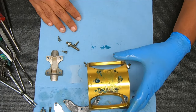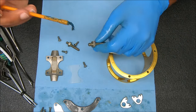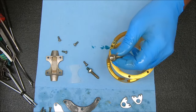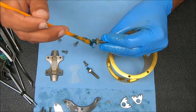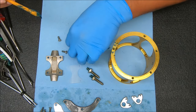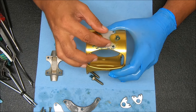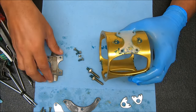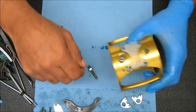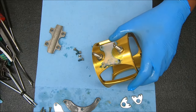Now we're gonna add some grease to these screws. There in the bottom. These threads. Now we can lay this gasket over it. Just make sure it lines up. Sometimes you put these things on and you have to rotate them. Go figure. Well, before I did, I'm going to add these studs. They're easier to deal with when there's nothing in the middle.